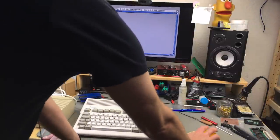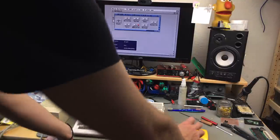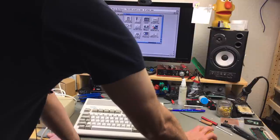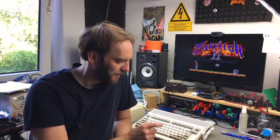Yes, it boots from hard disk! Really nice. We have a pretty snappy hard disk — it seems to react quite quickly. As is kind of tradition, I'm ending with some Turrican 2, which I always play as a test game whenever I have an Amiga refurbished. I think this turned out pretty nicely. I still have to find a workaround for the hard disk LED being permanently lit — I had a similar issue with my Amiga 1200 initially, so maybe there's a workaround. I think it's just a wiring problem in the SD card adapter.